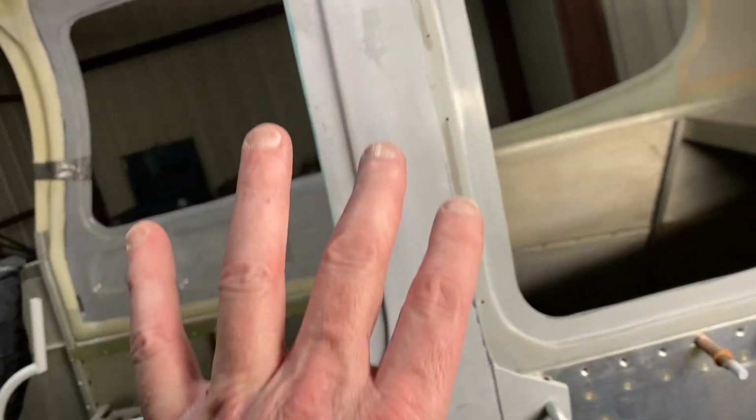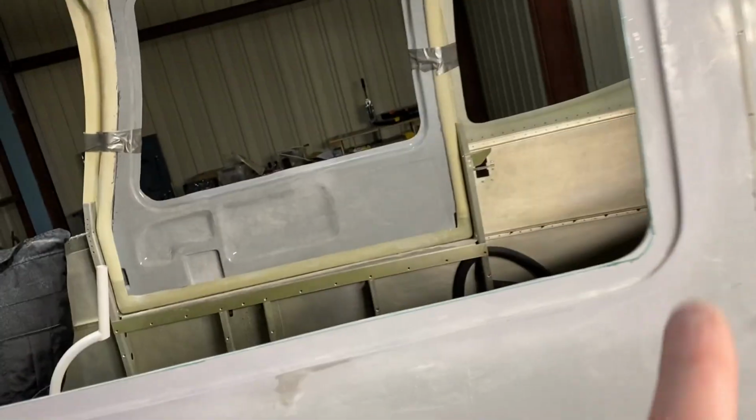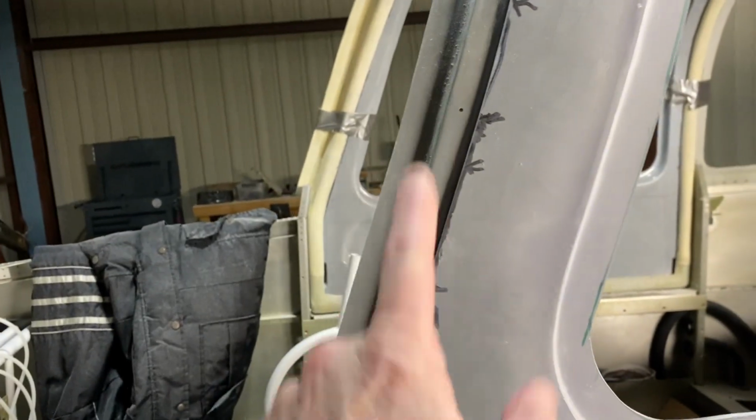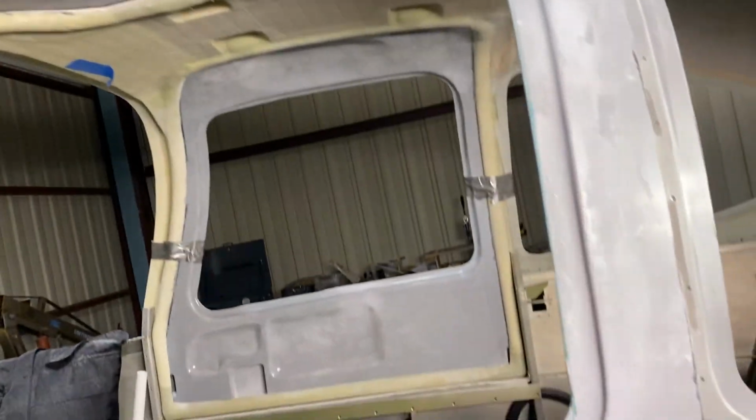And I would say definitely having the clecos on here, both sides, makes it a little easier because the door always goes back in the same position. So when I trim the back here, I know that that'll be done. And when I trim the front, it'll be done and it won't tip. Now, obviously, once I put the hinges on it and start swinging the door, I'll have to continue to tweak it, but I think it's heading down the right path.